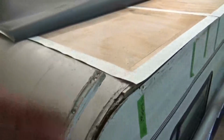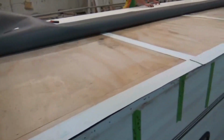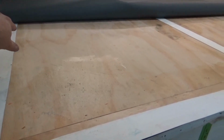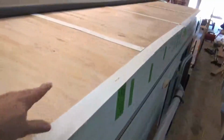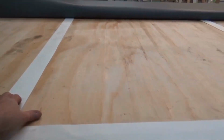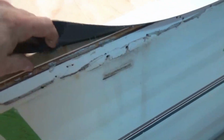Mostly that's where, when the girls do the videos, they know what video we've got on what coach. So now we're pulling this back. We've got one side already glued over here, so we're going to pull this back. You can see we've got our protective strips on here, and they go across where the sheathing comes together, and also on the edge. This protects the main roof from this sharpness right here. They just had tape on there before.